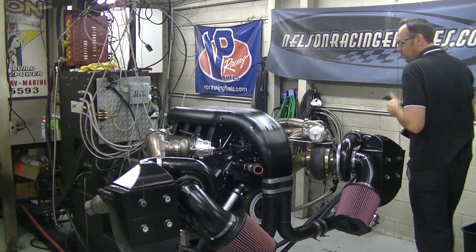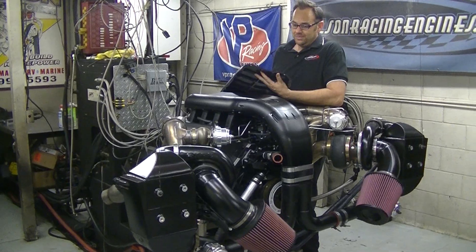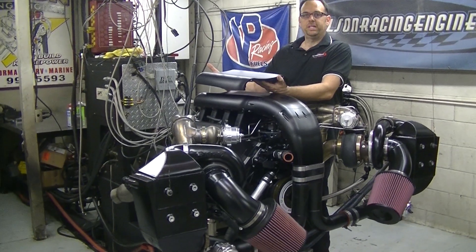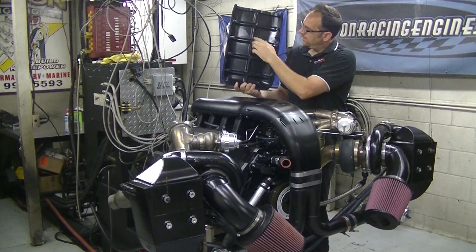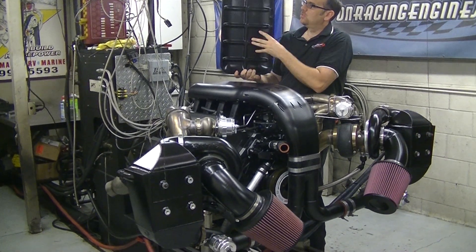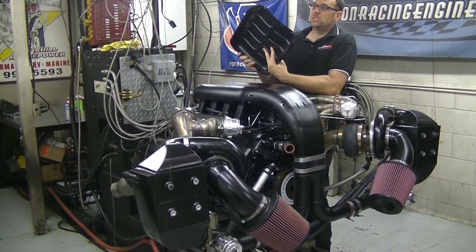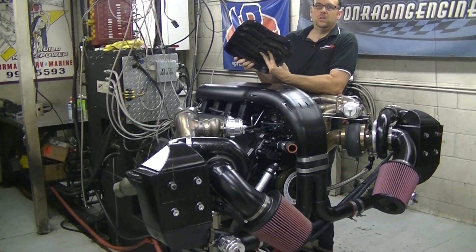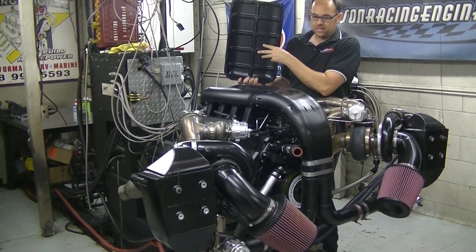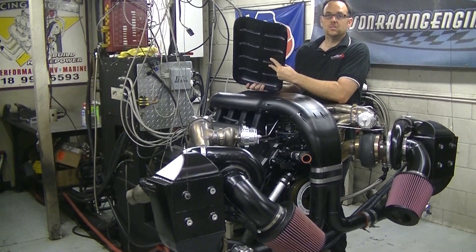You've got a motor making 2,000 horsepower under 30 pounds of boost pressure — an extreme amount of load inside. This is what we call the billet upper plenum anteater snout, and if you look at the inside, it's all internally trussed. We've gone through three renditions of these trusses to get it to where the manifold doesn't flex. Without trusses it actually looks like a lung when you're running it. The motors we're doing these days are just getting nicer and nicer.